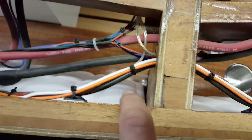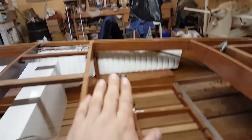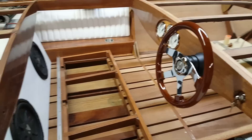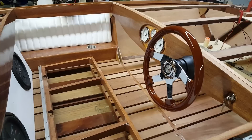These will eventually be attached with two-inch hook-and-loop — everybody else calls it Velcro. I'll run either three vertical strips or two long horizontal strips, and that'll slip in place. This front piece is actually hanging out about an inch — looking down from the top you can see how this one's all the way tucked in against the hull and this one's poking out. If I reach in and push it back that's how it should look. Because the side of the boat has a bit of a twist, you have to conform these panels to fit — the Velcro will do that. Super super pretty, looks awesome — the upholstery shop did a fantastic job, and if the seats turn out anything like the kick panels it's going to be really pretty in here. Please subscribe, rate, and comment, and we'll catch you on the next update of building the zip.